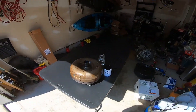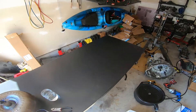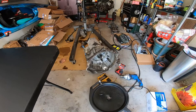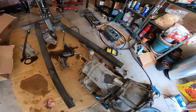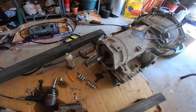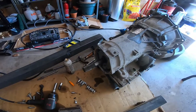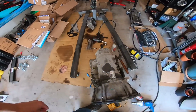Just a quick tour of what's going on here. I've got a table for putting all these parts on. So far I've got the torque converter removed - not hard. I've got the extension housing removed, and we're actually going to be changing the output shaft to that of a two-wheel drive because this was originally a four-wheel drive transmission. So we're off to a very strong start.